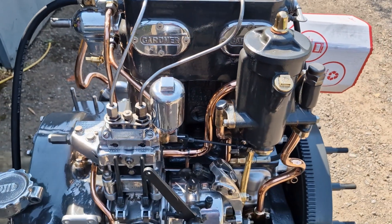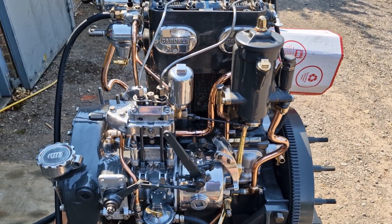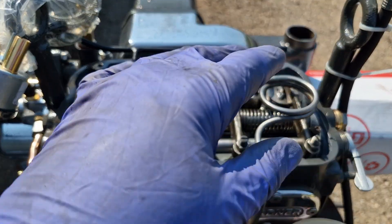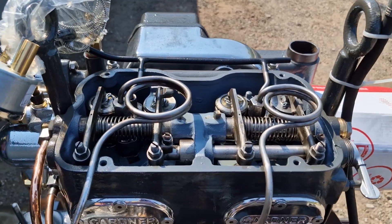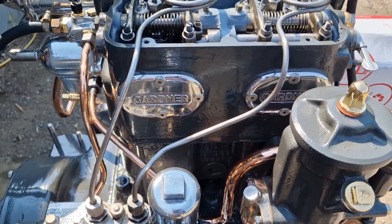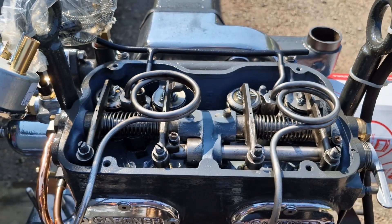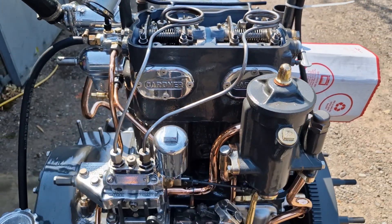So anyway, we've done that, we've filled it with oil, we've cranked it over to get oil pressure which we have, so there's oil around it. When filling with oil for the first time we tend to do a couple of litres in through the top of the engine to make sure that everything's lubricated up here — that runs down past the camshaft on the way back to the sump. Then we put the rest of the oil in through the oil filler. What we need to do now is see if the engine starts, check that we've got good oil flow from all the oil ports on the rocker arms, and everything looks good in the top end. Then we can bolt the rocker cover on and it will be time for the engine's test run.